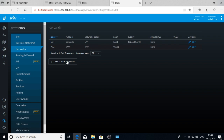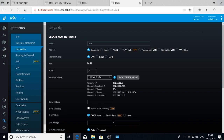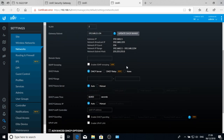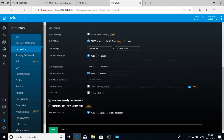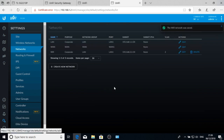Now we're going to create two new networks: a guest Wi-Fi network and a separate corporate Wi-Fi network. The corporate Wi-Fi network will have VLAN 2, IP address 192.168.2.1/24. The DHCP server will be enabled and we'll update the DHCP range. Leave the advanced settings and IPv6 as they are. Save. We're also adding a guest VLAN — VLAN 4. We're skipping VLAN 3 as it would clash with some stuff in the current test environment.